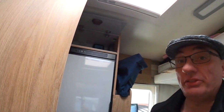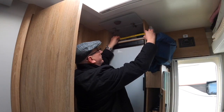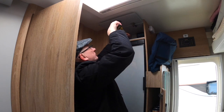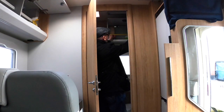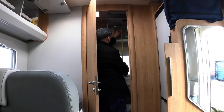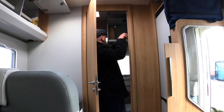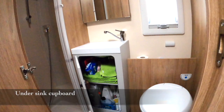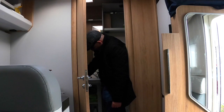There is also a little cabinet where the solar control is: it's 420mm wide, 165mm in height, and 260mm in depth. The upper bathroom cabinet is as near as damn it 500mm in width; height to the base of the door is 260mm; and the depth at its deepest point — because it's actually sloped a bit at the back of the van — is 180mm maximum. The maximum height of the aperture is just under 620mm.